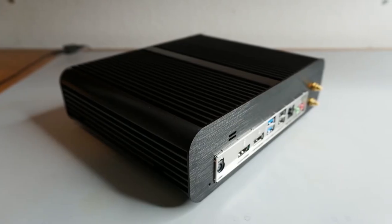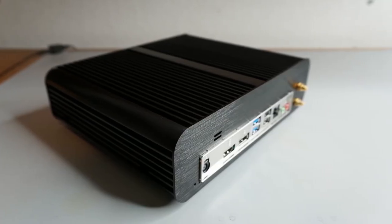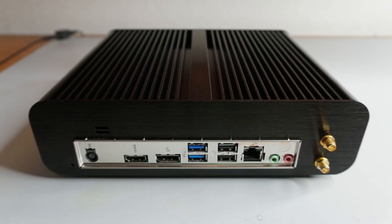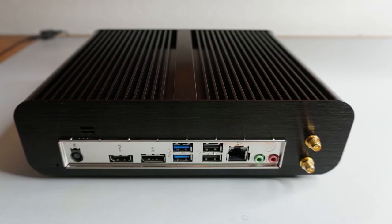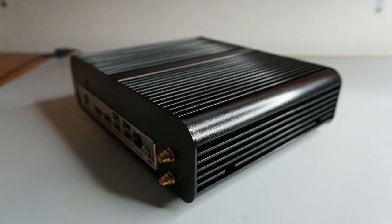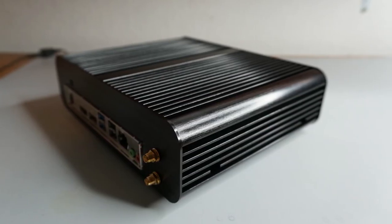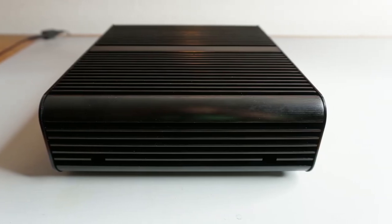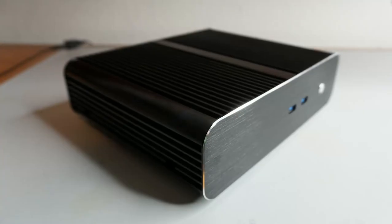It is one of the simplest fanless cases, with a large CPU block directly attached to the top of the case for thermal transfer. This is the only case of the four being compared that does not have any heat pipes. It is about 9.0 inches wide, 7.4 inches deep, and 2.4 inches tall, about 2.6 liters in volume.